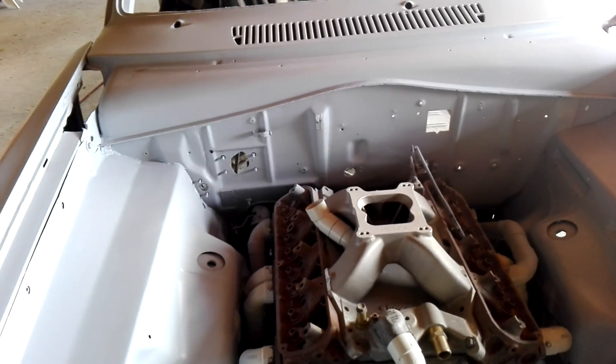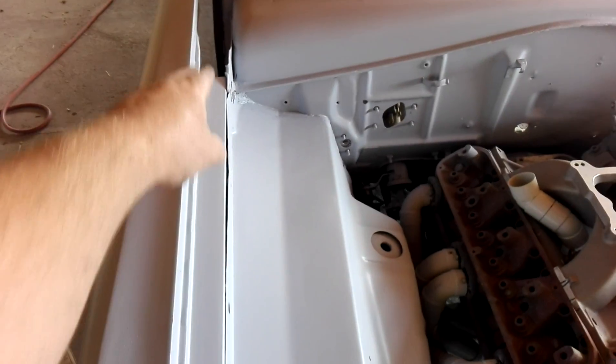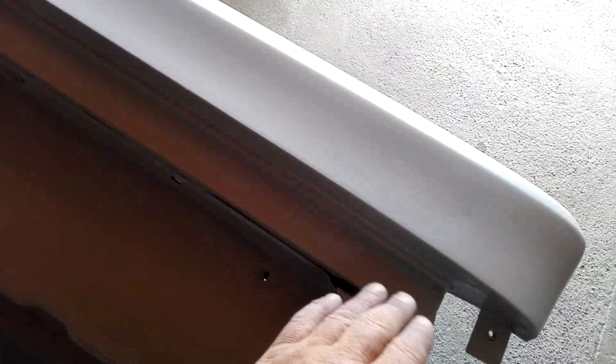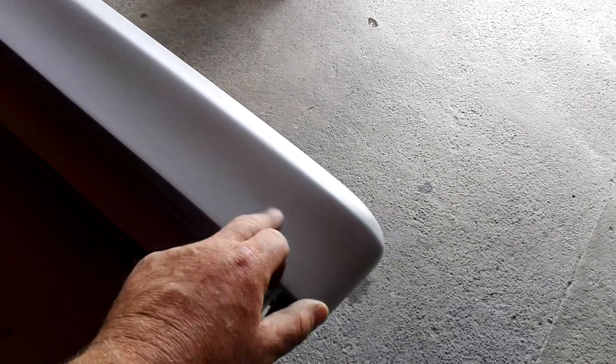As I said, it's not going to be a show car — I just want a real good clean tidy car, and we're going to get that. Like, these here were really ripply and quite funny looking before, but that's really nice and smooth now. There's the odd little spot that probably needs a little bit more spot putty or something like that, but geez, they are leaps ahead of where they were. Now that I've got a decent amount of primer on there I can see where it's going to shrink back, so there are a few little spots that need a bit of that dolphin glaze, including a little shallow spot that needs a bit more yet.